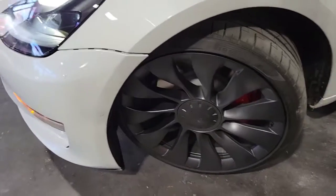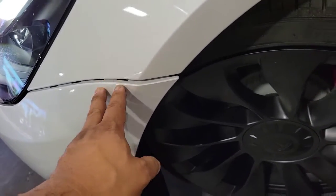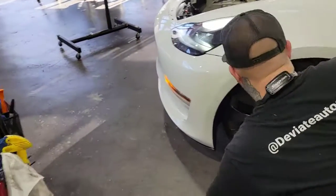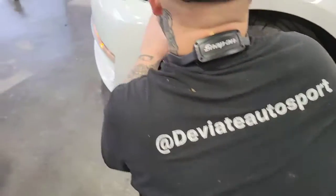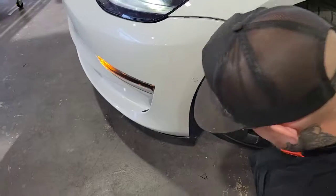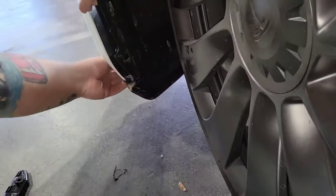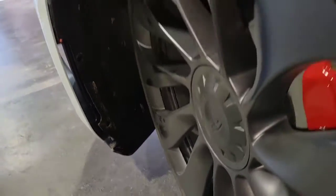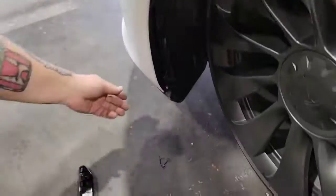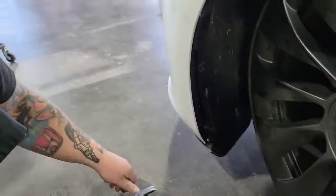Ready? So basically we came back over here and we turned the wheels to create clearance. And then under here, we're gonna remove the bumper bracket and then we're going to unclip this bottom trim. And what motion did you do there, Adam? Because I kind of blocked it. Downwards pulling motion. You downwards with the clip lifter? Yes. You just popped it down like that? Yep. Okay, perfect.